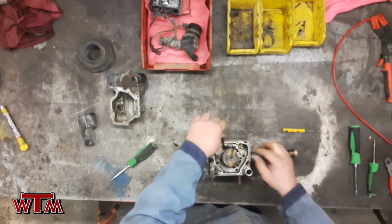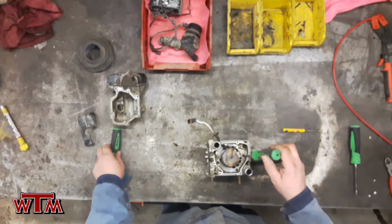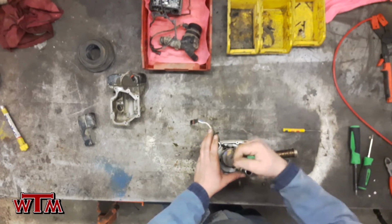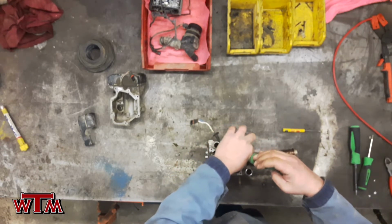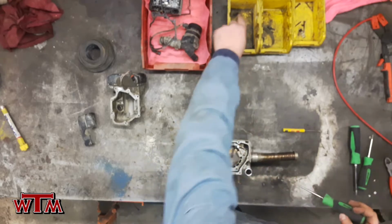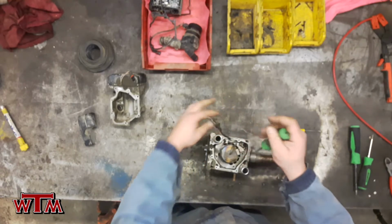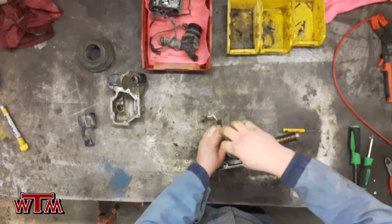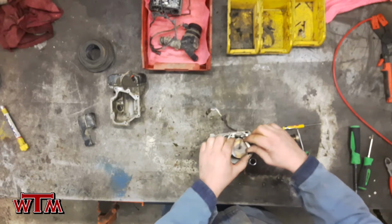And now we're going to move our combustion chamber itself. That's held in place with 4 Torx screws as well. And then I guess it's worthwhile mentioning too that you basically need 2 screwdrivers to disassemble and service this entire unit. Last screw out of our way here, and you just pull straight up on that combustion chamber, and that is going to come all out as one assembly.